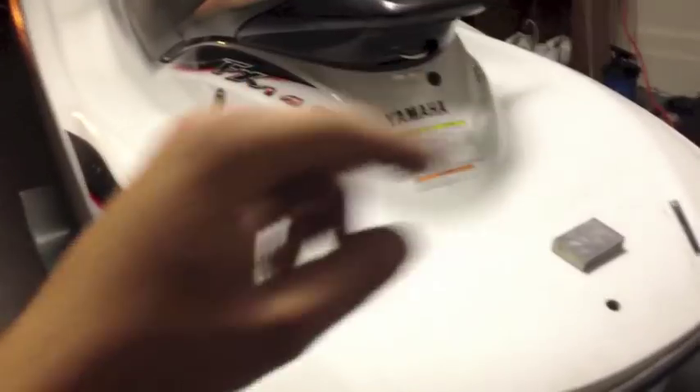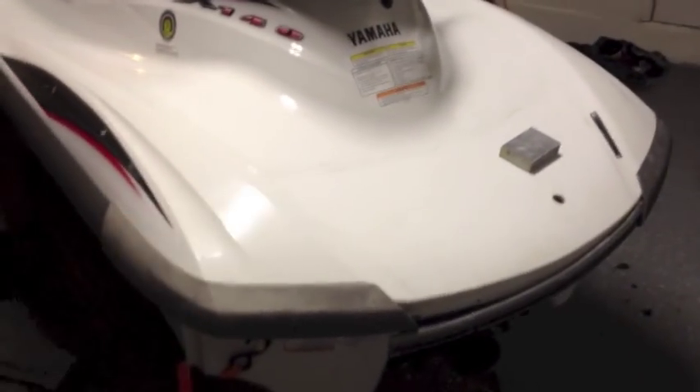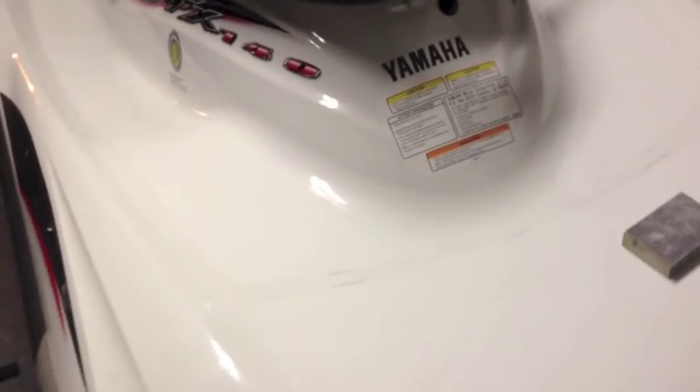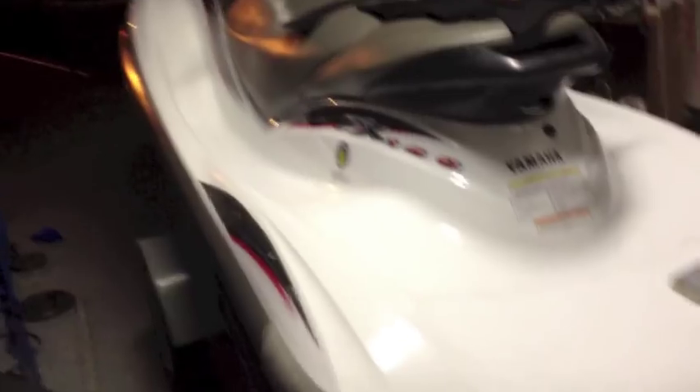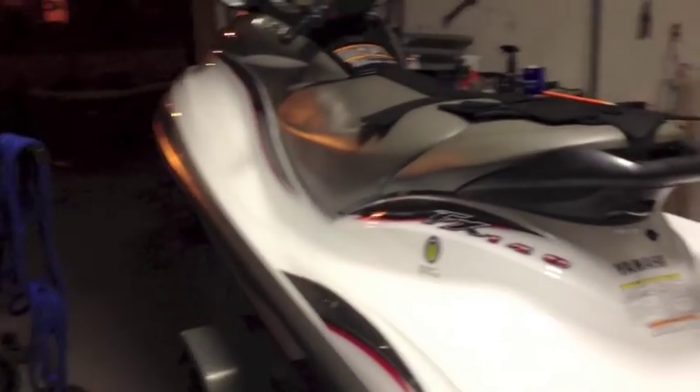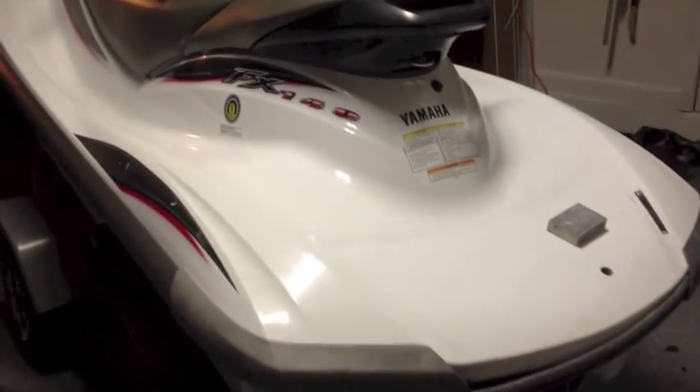What I did then was I placed the mats and outlined them with pencil. For the hydro mats, it says that you need to take off the shine — it won't stick to a shiny surface. So where the mats are going to go, I basically sanded it down and took most of the shine off. The pencil line told me where to sand and where not to sand. After I do the remaining three mats, I'm going to take it outside and give it a wash down to get all that residual sanding dust off.